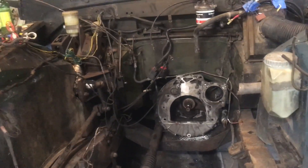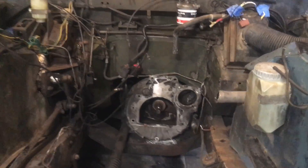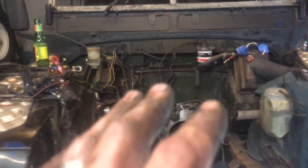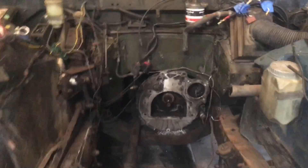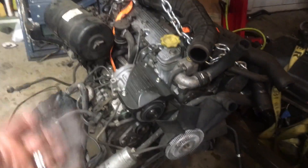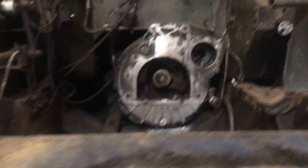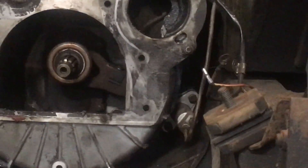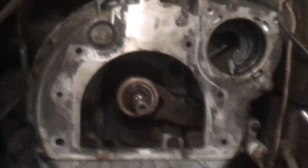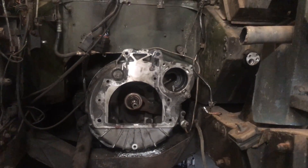This is going to allow me to now dry fit the engine. I'll go ahead and get this off the back — I'm not going to put the clutch in, which will make alignment and settling it down so much easier for a one-man job. As I finally drop this in play, I'll start to see issues such as: will the alternator foul with the chassis? I've heard that it might, so I may have to move the alternator where my air conditioning pump is, which I don't want to do because we're trying to put an air conditioning system in this. We slowed down a bit to get this right, and I'm very pleased with the clearance we now have for the slave cylinder and for the drive shaft. I might even mill that down a little more when it's finally ready to go — but for now it's good and I can do my dry fitting.